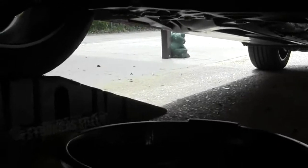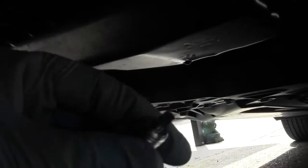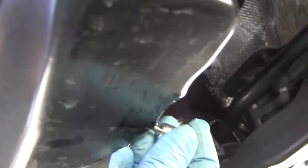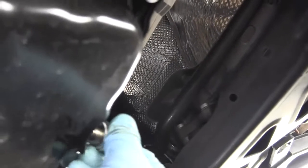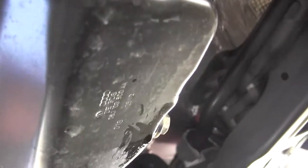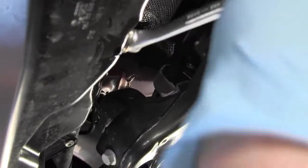When you see the oil dripping, which it is right now, put it into your oil pan. Then it's about time to put your plug back in again. I wiped it all off with a paper towel, so we're good to put it back in. Don't change out your washer unless you've got a leak. I know that everybody tells you to do it — don't bother. Some cars come with a washer that lasts almost as long as you're on the car. I've never had to change one out except on a Volkswagen.